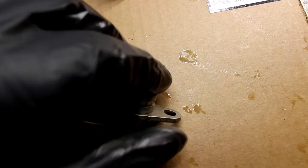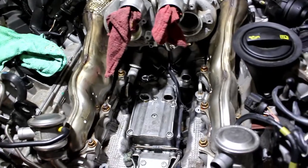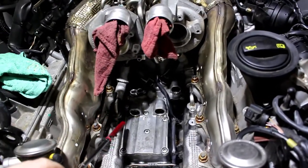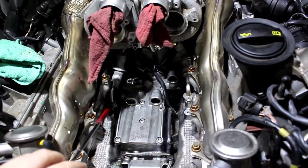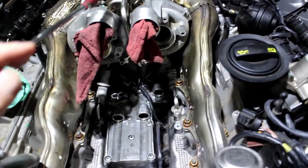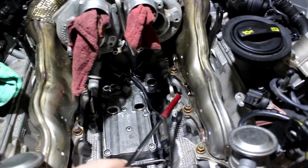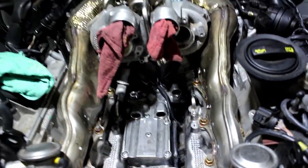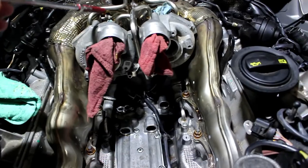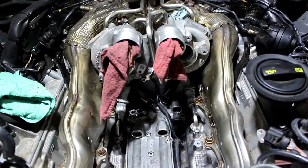This was a really cheap investment and these go on really easy. I got the coolant lines back in. One thing to point out: you have to start with the passenger side coolant line first, as the driver side coolant line wraps on the outside of it.